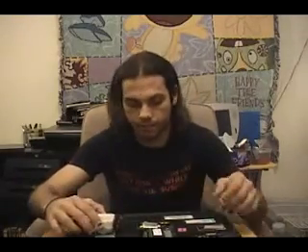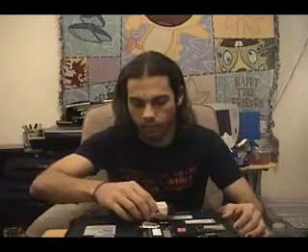Let's get a little bit more complicated. Here's a broken Toshiba Satellite Series laptop — I have no idea what's wrong with it. I was actually able to use the pickup coil to determine that it could be the CPU. If you hear that, that's actually the power circuit going through the front side bus. Keeping in mind that right now this laptop is off, yet it's still receiving power but it won't turn on. There's nothing going through the RAM. The power inverter for the actual backlight is getting some kind of noise. Yet the CPU is getting a very faint amount of EMF on it, which means the CPU is getting power but not responding to any kind of power-on sequence.